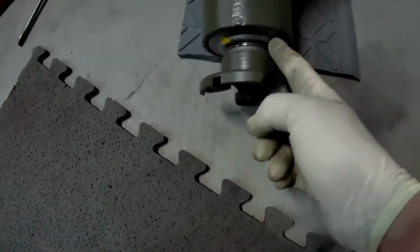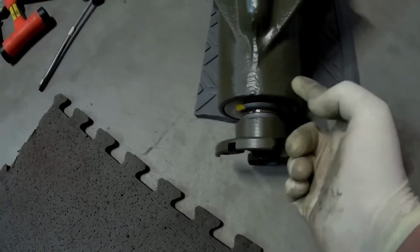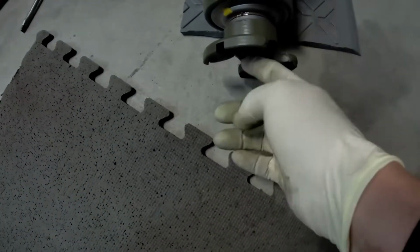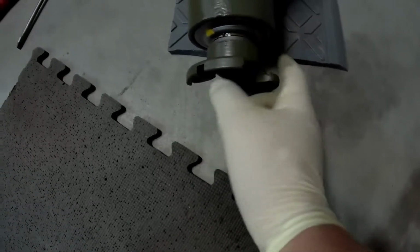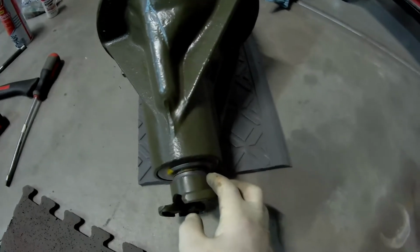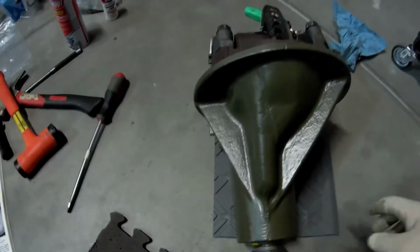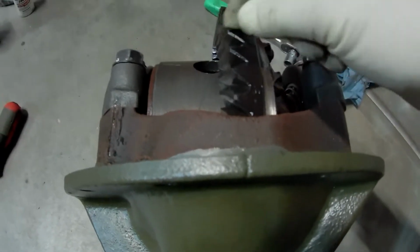For you guys, I got the oil seal, the oil slinger. There's a slinger in there underneath. The bearing, all that stuff is all together. The nut is on, holding the yoke. Everything turns super nice, smooth, brand new seal, like I said. And then I did the proper pinion to differential spacing.